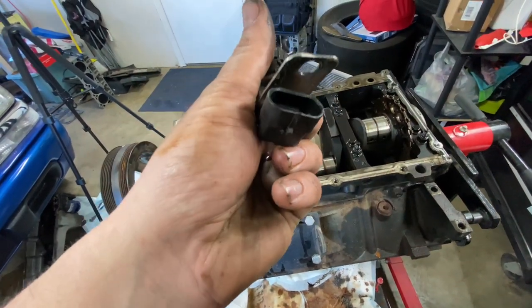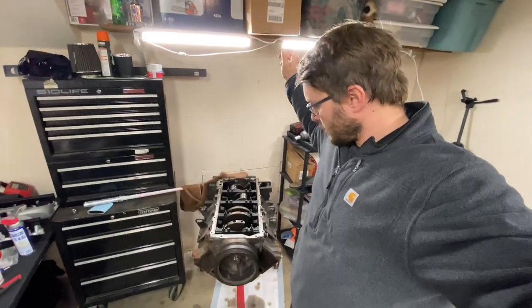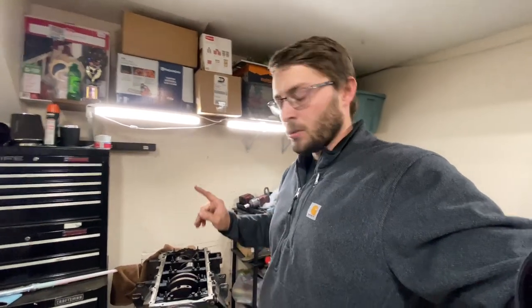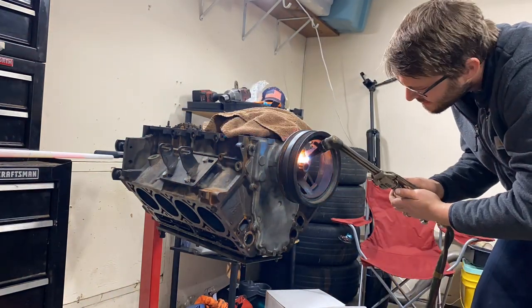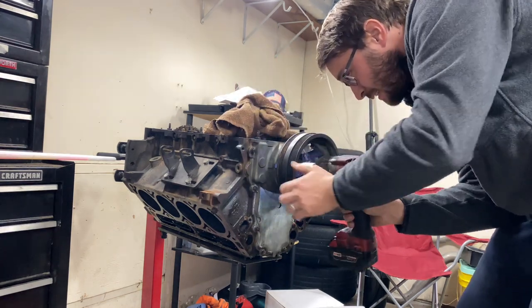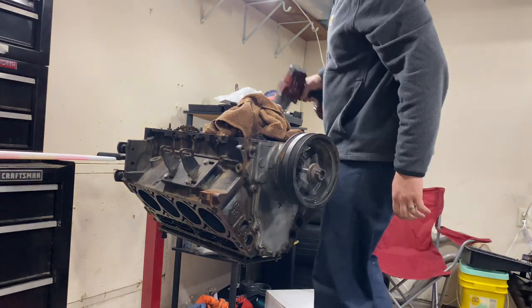I'm not sure if I'm going to replace the crank sensor before I put the terminator on it - the little prongs down in there don't look too bad, but we're just going to replace it. It's been a couple days since we've worked on this thing. I can't get the crank bolt out - we've tried, had three people on it and it won't budge. So we've got the heat wrench here today and it's got no choice but to go. Don't catch that towel on fire! All it took was just a little bit of blue wrench persuasion.